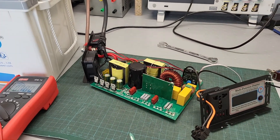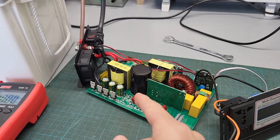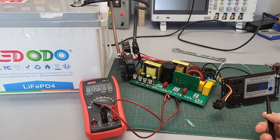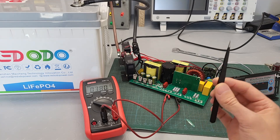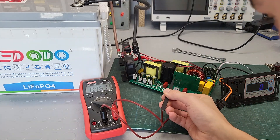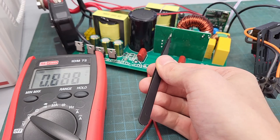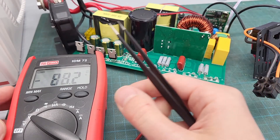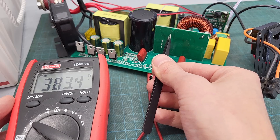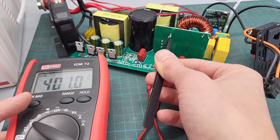This should bring the DC-DC conversion section back to life with 400 volts. I reconnect the battery to the inverter. After removing all the gate drivers and restoring the auxiliary supply, I want to see if I at least get voltage on the DC link. Powering on — that's a good sign, something is alive! But unfortunately the DC link voltage is still zero. With a pair of tweezers I short two pins — not exactly relaxing knowing voltage may jump to 400 volts — but all in the name of science. And there it is: the inverter is active, voltage is up to around 400 volts! The DC link is working, it just needed a little jump start, even peaking around 410 volts.